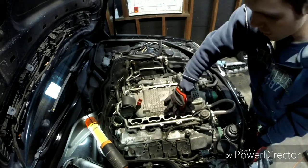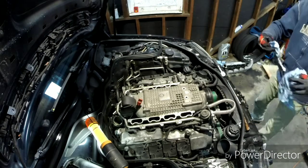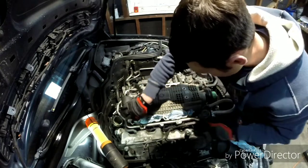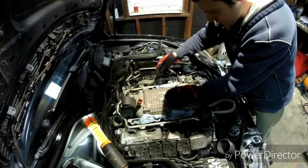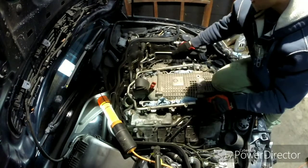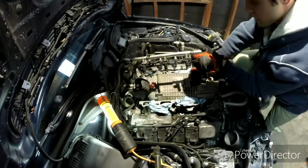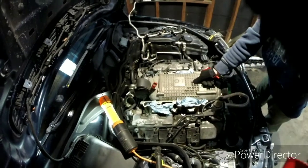Block off the intake openings with paper or towels. When I first took them off there was a lot of junk and debris underneath the back sides, and some of it fell down into the cylinder. Thankfully I found it and had to use a vacuum cleaner to get it out. When you unhook the fuel rail, this one just pops right off and you can lay it to the side. The other one lays down in there — lift it up, push back, and wiggle it around because a little regulator on there gets in the way. Just lift it up and lay it down off to the side.